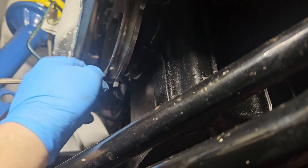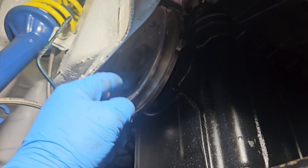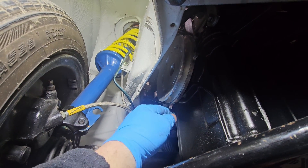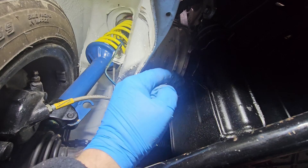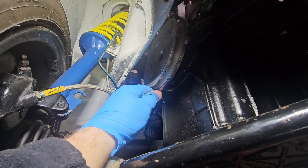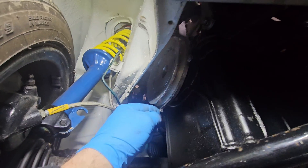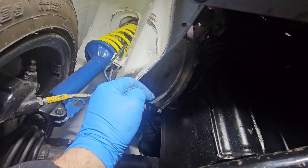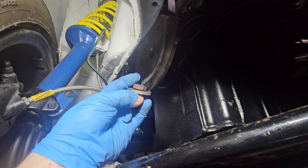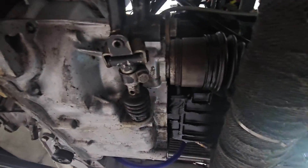This was destined initially for the Cosworth system. It's got a four-position pulley wheel bolted to the rear. I've decided to pull this off because I think we may upgrade it. This has got the Cosworth bottom pulley arrangement with equidistant teeth. I'm thinking we'll upgrade this, because the bolts on the back to adjust it were just hand-tight. And the more I've gone around the car, I've noticed lots of bolts missing — the starter motor's held in by one, the gearbox by three. So I think it's a good time for a nut and bolt check.